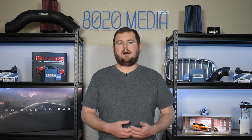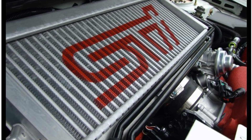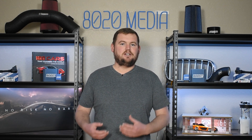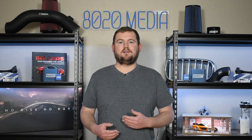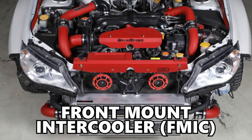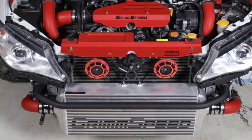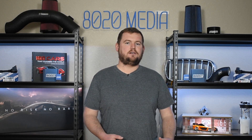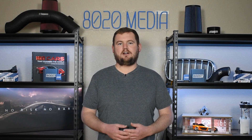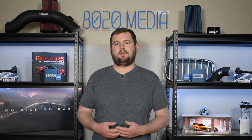A top-mount intercooler upgrade is a great option. A lot of people simply convert to the WRX STI intercooler — it fits into the factory location and is a simple, inexpensive upgrade. The stock STI intercooler is a great option if you're just looking to stick with the stock turbocharger and basic bolt-on upgrades. However, if you're looking to take things further, there are tons of other great top-mount intercoolers on the market. The most advanced route offering the best cooling is converting to a front-mount intercooler, though this is a lot more complex and expensive. It's overkill on most EJ255 builds, but if you're really pushing past 350 to 400 wheel horsepower with an upgraded turbo and fueling, a front-mount intercooler can certainly be an excellent option.